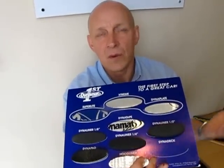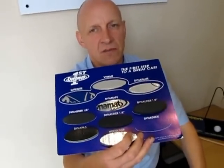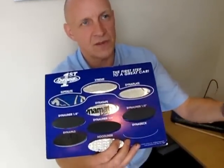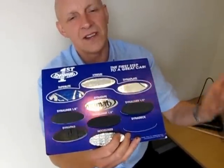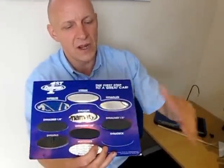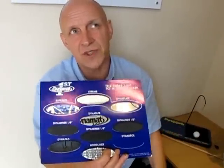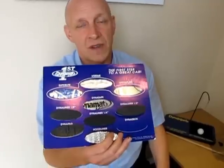There are classic car restorers — like Aston Martin, for example — who use this. When they restore these vehicles, they look great and run great, but they still feel like an old car and get really hot in the summer inside. That's the heat transfer coming from the engine and gearbox through into the cabin. You put Dynaliner on here with the Dynamat, and we've proved it time and time again — you get over 60% drop of the thermal transfer of heat from the engine bay.